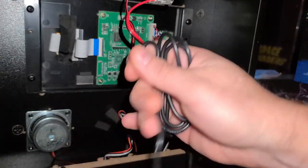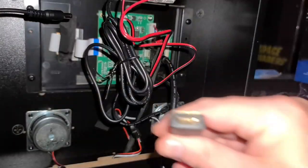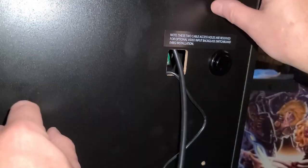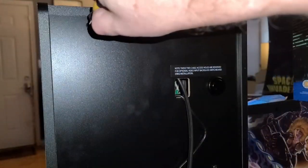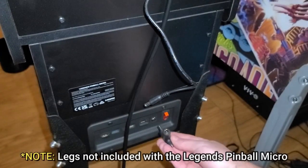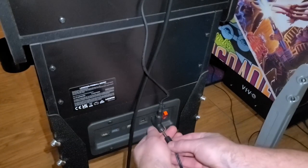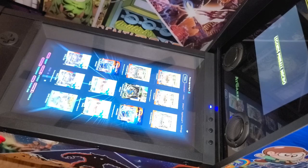Wrap some of the excess length of the power extension cable and feed the power and the other end of the HDMI cable through the pre-cut hole. Place the back panel into position and then reinstall the four screws to hold it into place. I use some extra leftover tape to provide a little extra stress relief on the HDMI cable. Now take the included power splitter and plug in the power extension cable and the power going to the power adapter, then plug the power splitter into the Legends Pinball Micro. In the next segment, we'll check it out with a Steam Deck.